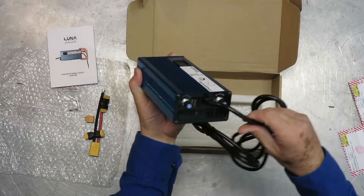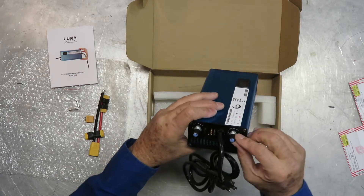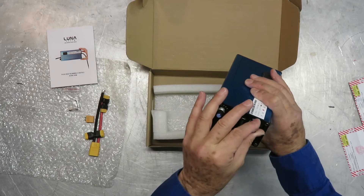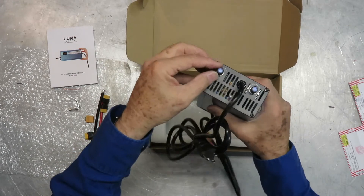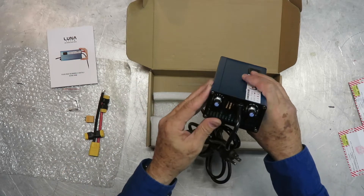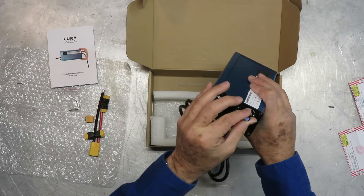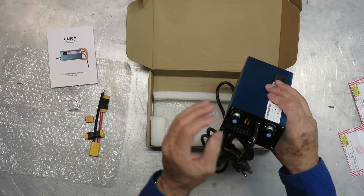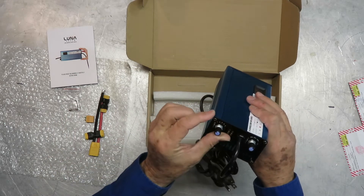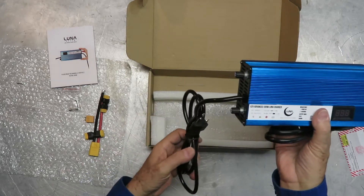On this side we have two rotary switches. One lets you choose the charge level: 80%, 90%, or 100%. The other switch controls the number of amps for charging — it's currently set to five, but you can go four, three, two, or one. So the rate of charge can be adjusted as well as how full you want the battery to be. If you run it at 100% and five amps each time, the battery life won't be what it could be compared to charging at two or three amps and 80% — you'll get more charge cycles with the less aggressive charging settings.